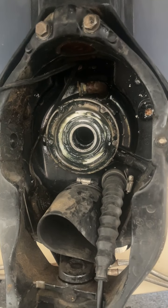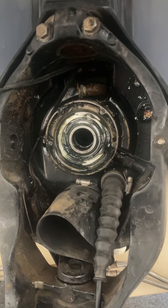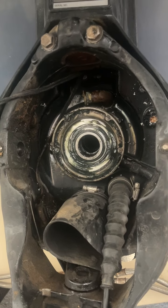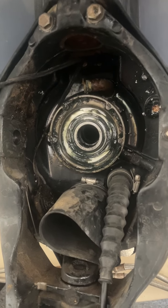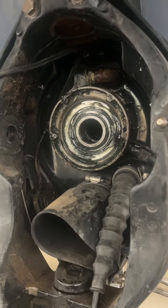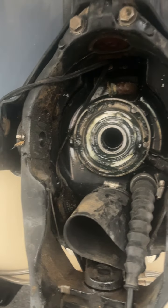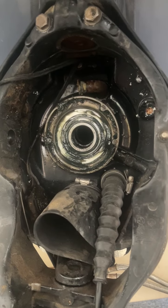And on this older boat, I think what's gonna be best is just use some good epoxy practices and clean that up real good, epoxy it, maybe try to sand it and epoxy it again, and that'll probably hold for a long time. But no doubt, I don't know how long it's been taking on water, but no doubt there's some damage in the wood transom back behind there. I think that's a certainty. So eventually this is just gonna have to be replaced.